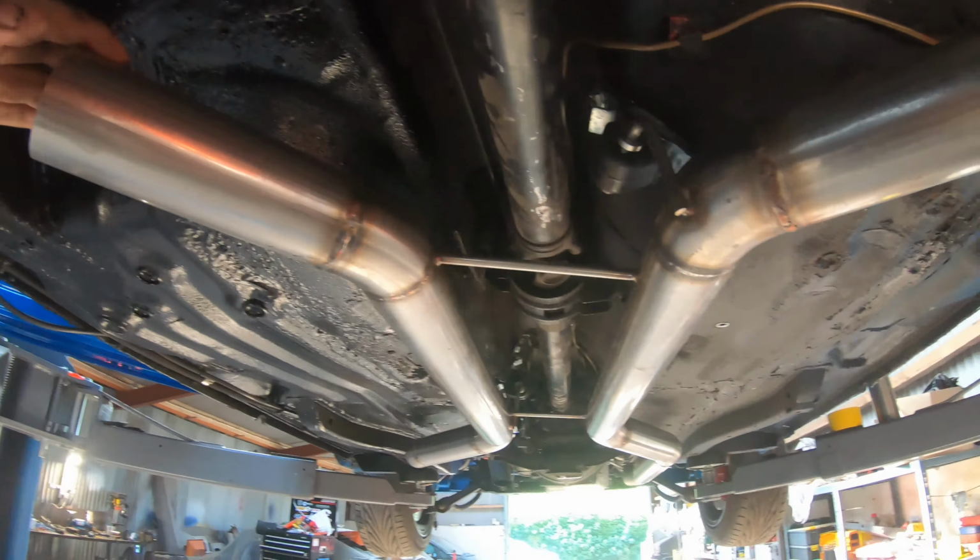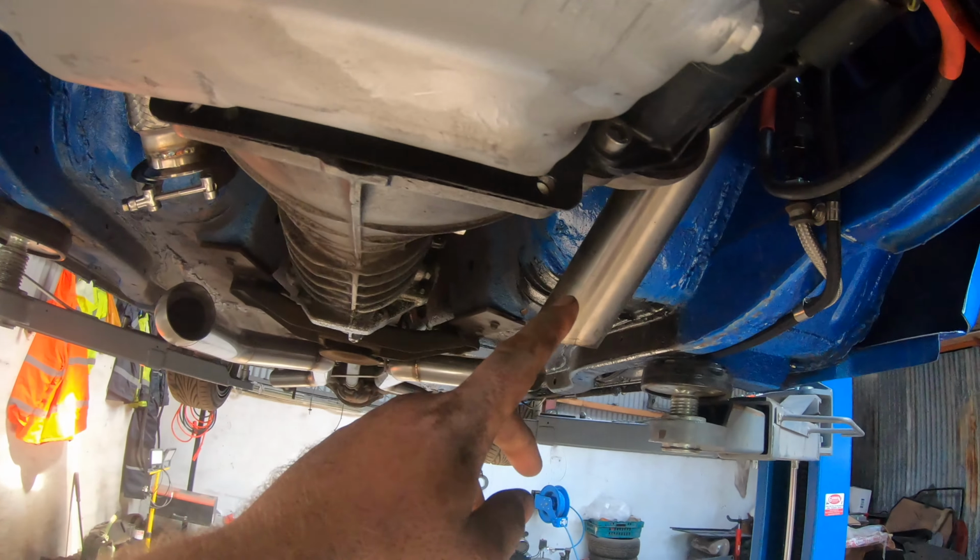Once that's done, then it's just, well, whatever I say, we need to get it pointed out over the rear axle and the silencers and tips on. So it is proven to be time consuming, but for instance, we'll have to start pie cutting this bit because it just was not handy to get the angles that we needed with conventional bends. So yes, progress has been made. I'll update you in another wee bit whenever we hopefully have this linked up and this linked up.